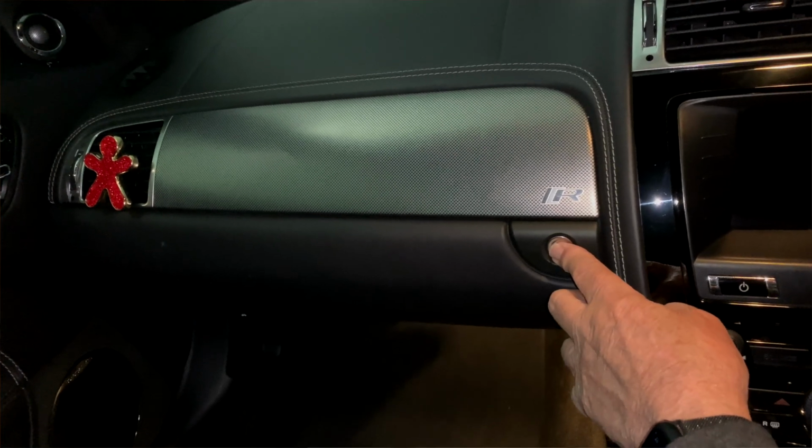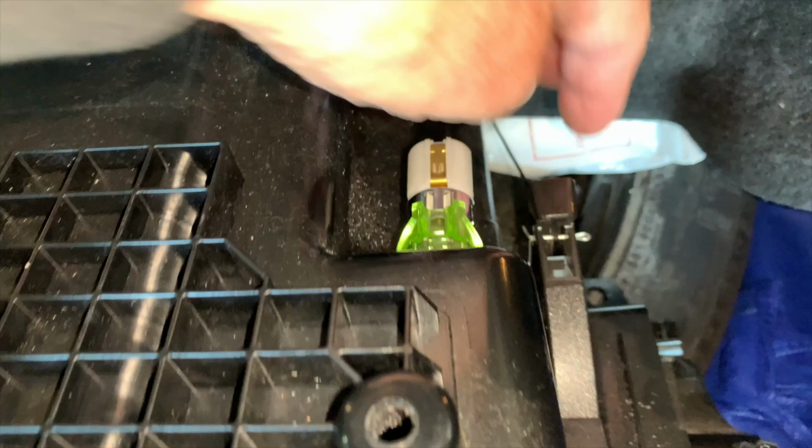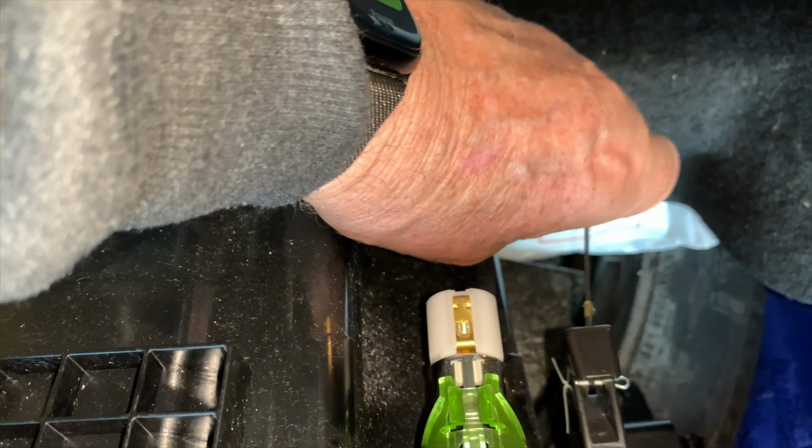The headlining is prone to sag, and this is a very common fault, so look for loose material on the A-pillars and any signs of sagging, particularly around the rear window. The dropping glove box is also a common issue, where that soft opening mechanism fails and the glove box opens sharply. It's a fairly easy DIY fix, but it'll give you some bargaining room on price.